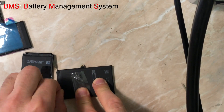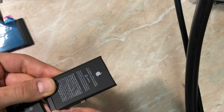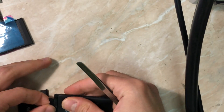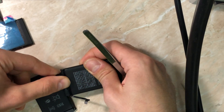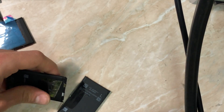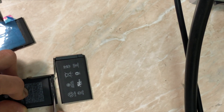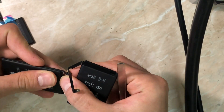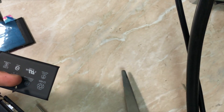For the replacement battery, the main focus will be on the battery cells themselves. You can also find replacement batteries without a BMS board for sale from China, but I can't recommend those because I've never tested them. Most of the black stickers I'm removing are for short-circuit protection. These stickers are not easy to remove, so take your time — don't rush, especially if this is your first time. There are two batteries connected to the BMS, as in the XS Max, iPhone X, or iPhone 10. All of this work is specifically to eliminate the important battery message.